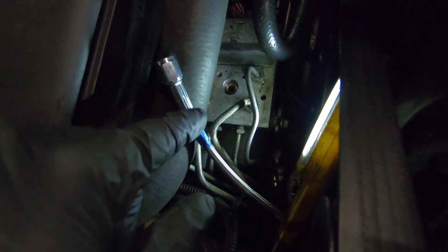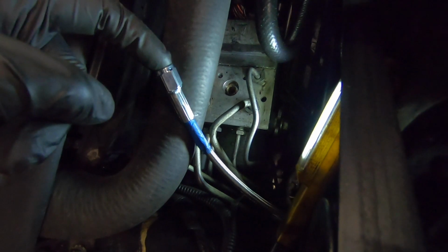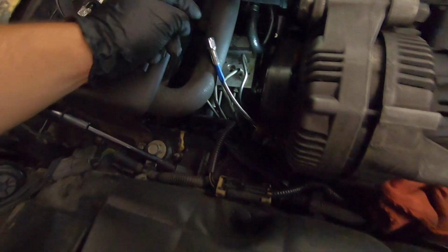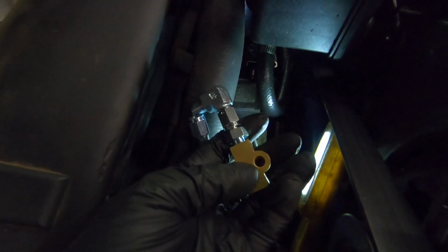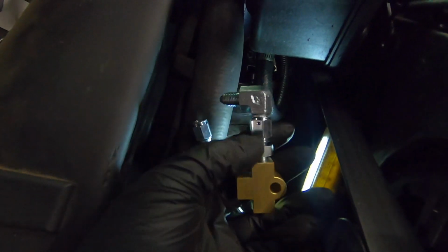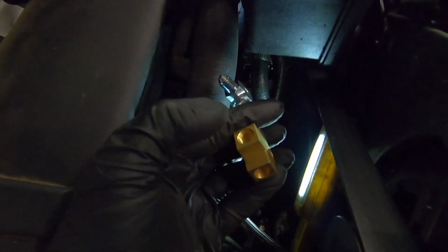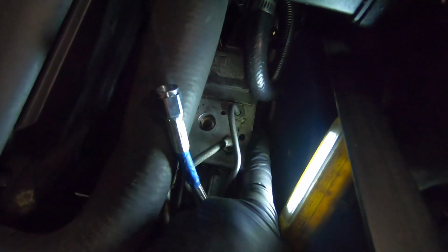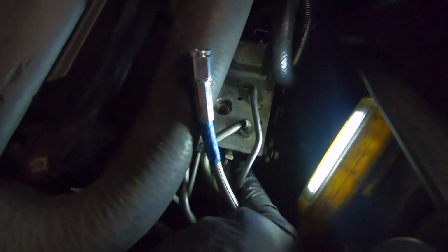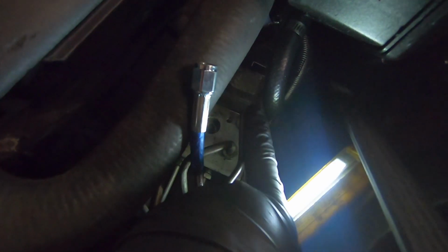The new line that's going to be the master cylinder feed is what's coming from our handbrake master cylinder. So that's that stainless line that we just ran through the car. I'll show you the rear T-block first. So that is going to go right there, right into our AN line, and then we have two outlets. These two outlets are for our rear brake hard lines, which are these two lines right here. So this one I believe is the right rear, and this one is the left rear right down here. So our T will go to this line and this line for the rear brakes.